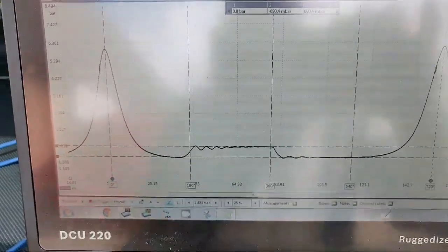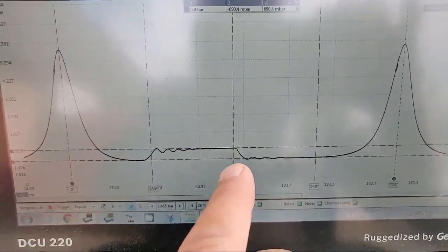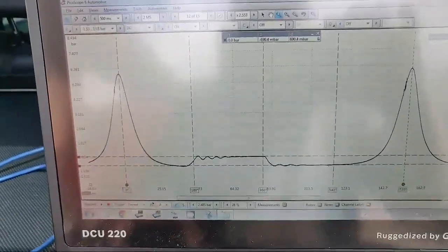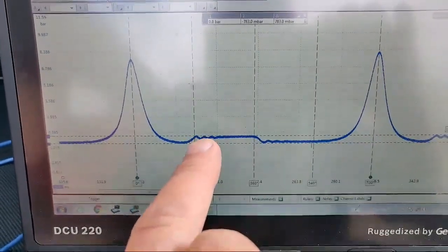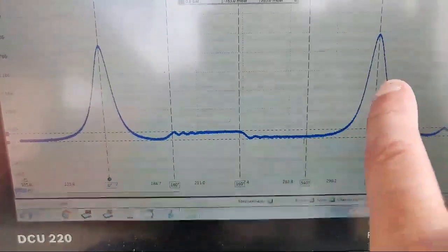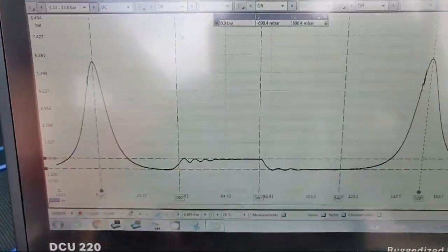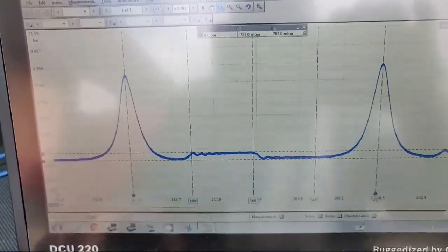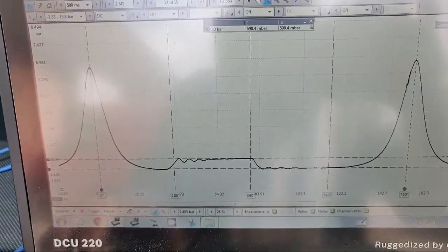The vehicle's got no VVT or anything like that, so our 180-degree mark is halfway up the exhaust ramp, and our 360 you can see is a few degrees before it drops off. Now looking at the new cam - the 180 is in a significantly different place, about 10 degrees different. Look where our 360 is, and also look where the compression is starting to build up. So that's the replacement cam, this is the original cam - same cylinder, cylinder two.